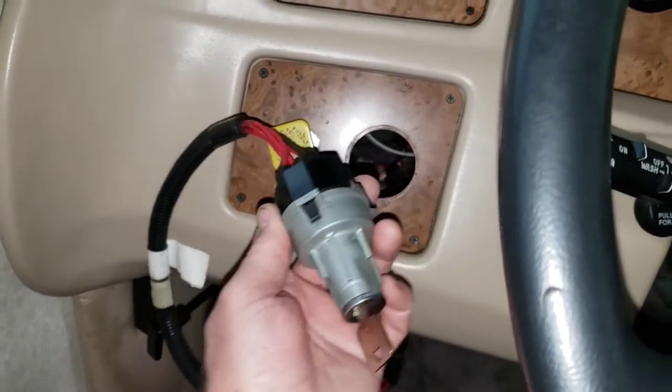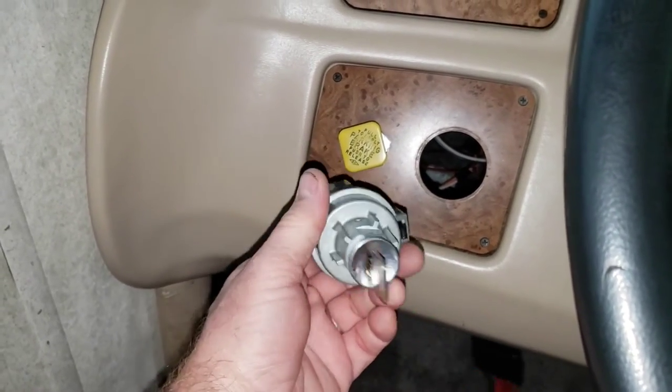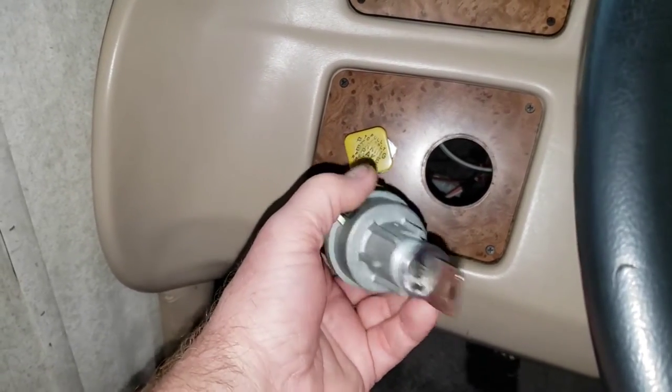All right, so this is a standard part. You can get this down at Napa. I'll put the part number in the description below. Sometimes your ignition switch can go bad. In this case, it did not. I replaced this and it did not correct the issue.